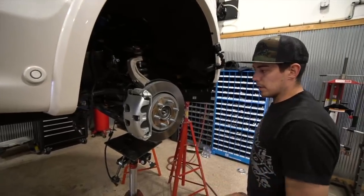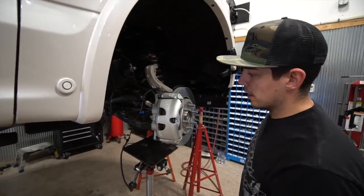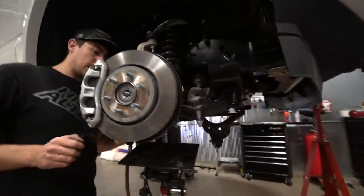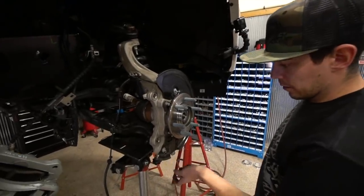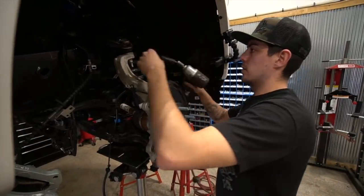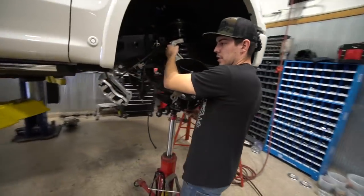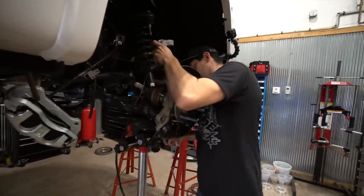We can do this a couple of different ways. What I find easier is just taking the whole knuckle off — it's only one extra nut but it gets everything out of the way and it takes maybe an extra five minutes. First we're going to take off the caliper, which is a 21 mil, hang the caliper off to the side, and take the rotor off. We've taken out the lower control arm nut which is a 21 mil, and then we're going to take out the upper control arm which is an 18 millimeter. I'm using a wobble to access it with an impact — you don't have to do this. Since this truck's brand new, all our ball joint tapers are coming off pretty easily, so we didn't even need to use the hammer, but for most of you guys you're going to have to.